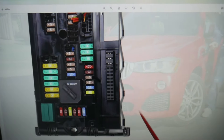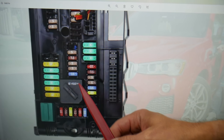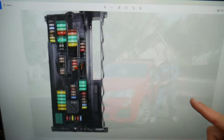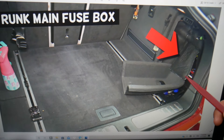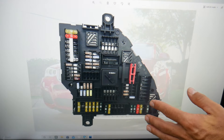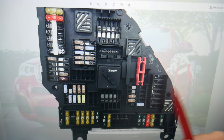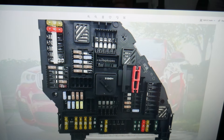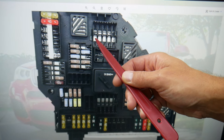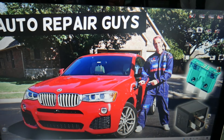In that glove box fuse box, there's just one fuse to check. In that row, you need to check a 15-amp fuse known as fuse 35. Then open the trunk on your BMW, remove the cover from the right side, and lift the insulation up. Behind it you'll find another fuse box where you may need to check up to three more fuses — fuse 131, fuse 132, and fuse 143 — depending on your trim level and engine.